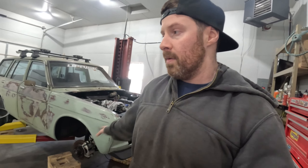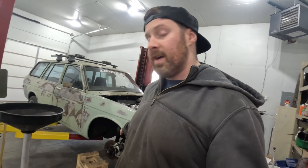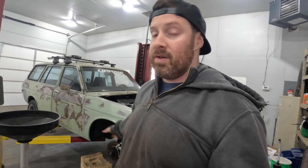If there's anything major back there that's a disaster, we could always just plug the rear line and just pray. While they're doing that, I'm going to work on the front. We've got to replace all the suspension anyway because everything on here is trash - the bushings are junk, the ball joints are junk, tension control rods are junk, everything. I bought all these parts from my friend already reconditioned - I can just slap them right in.